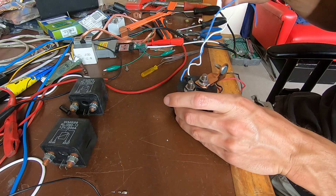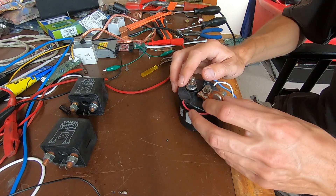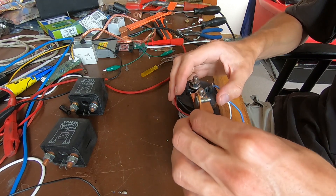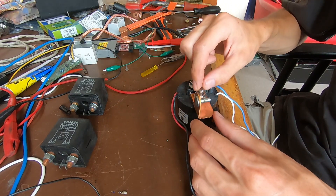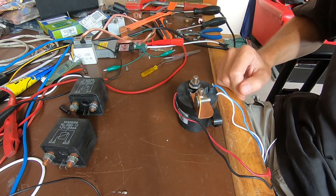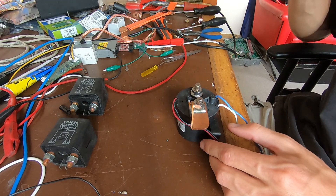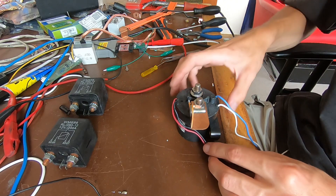At least this white one is out as well. I do consider just getting another black one and finishing the circuit with two of these. As you can see, I mounted one of those Nissan copper brackets on there — these change the studs from M8 to M6 because all the cable lugs in my car and various bus bars are M6. We're going to take a look at the DC junction area underneath the car in a second.